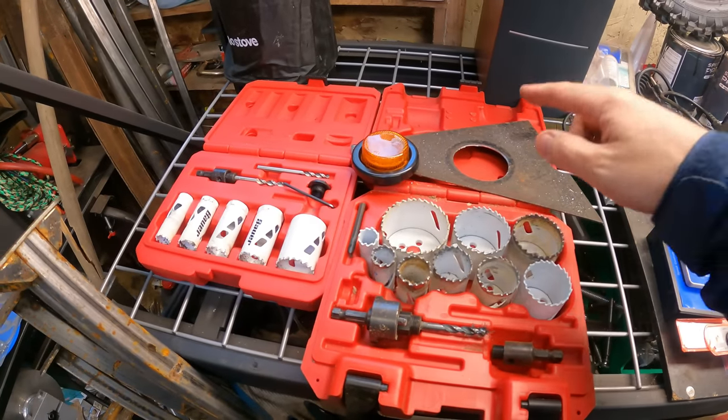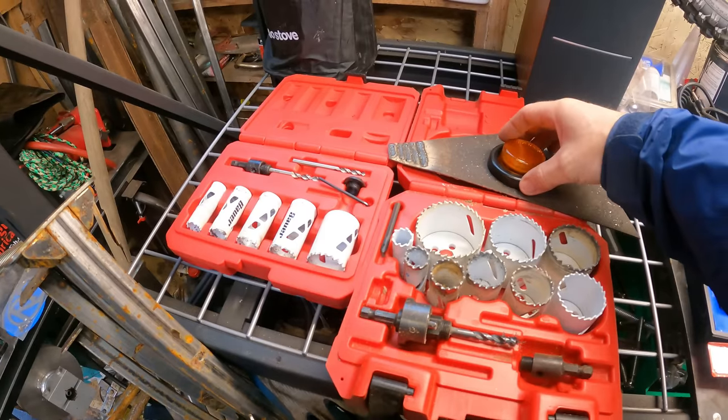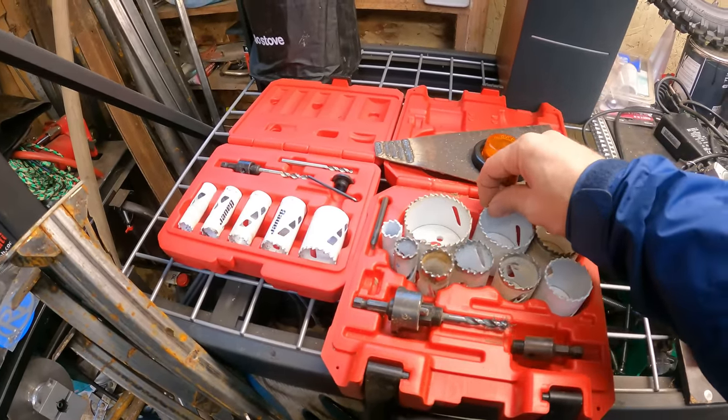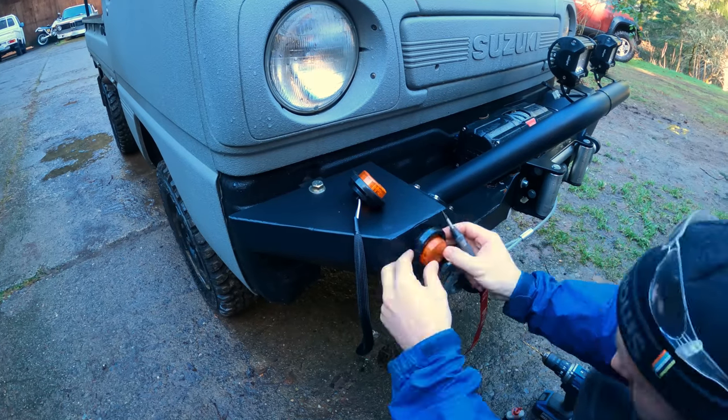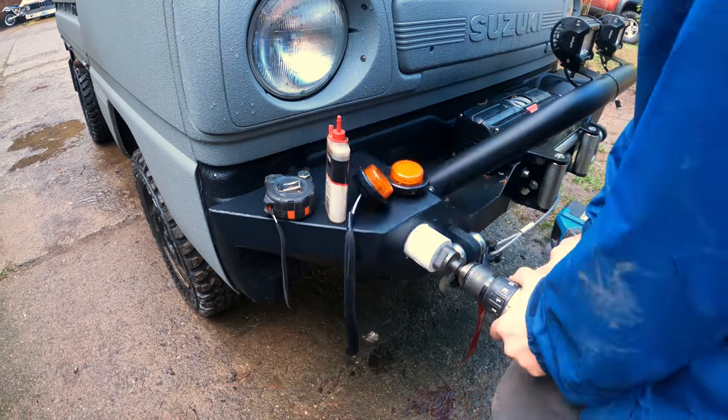Little predicament. Drilled my largest 2.5 inch hole. This drops in, locks in, but not very well. It's pretty loose. I think I need a 2.25. I go from 2.5 down to 2.125. So I'm gonna have to go for 2.125 and take a die grinder and grind it out until it fits. I just don't want to have them loose and falling out.